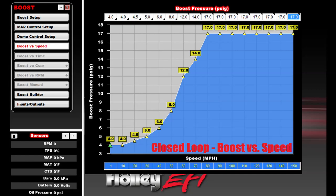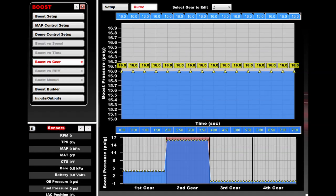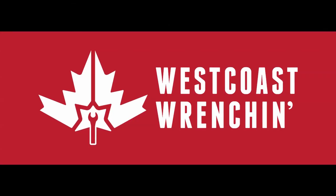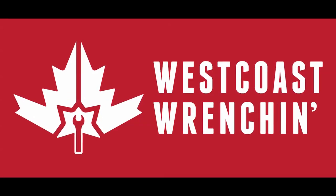The big advantage here is that you can run a really light spring and then apply air pressure as needed to the top of the diaphragm to adjust your boost level. This allows you to do things like boost by speed or boost by gear. My personal favorite is boost by speed because it allows me to launch at a low pressure and get good traction, then ramp up the boost as the car starts going faster. In the next video we'll talk about the computer control side and how to actually make this all work together.